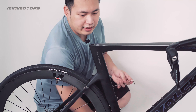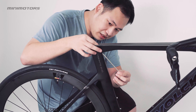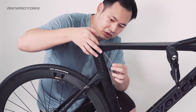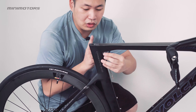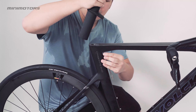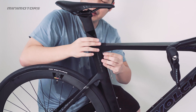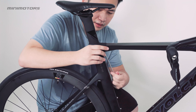Over here there is a screw, and you need the Allen key to loosen it — but don't loosen it all the way. Use your finger to hold the screw from inside to keep balance in case it drops. Then use your Allen key to hold the screw while placing the bicycle seat inside. Quick tip: to place it inside, go in at an angle, then turn it back to pull it down. Set it at the right height, then use the Allen key to tighten it. You are all set.